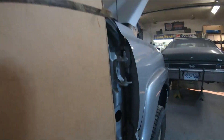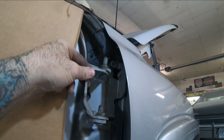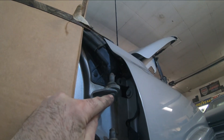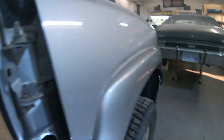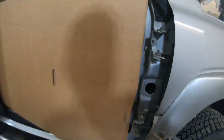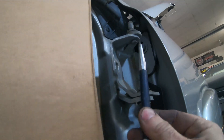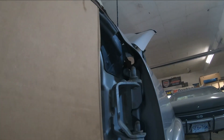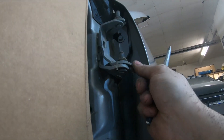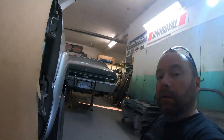Maybe I should have started this video on the passenger side. I was just getting ready to do this side and thought I'd show you what I was talking about. You can see this hinge also has a lot of play in it, and this is a factory door pin — you can see the way it's mushroomed over on the end. On this side I need to take a little cutoff wheel and just buzz through the bottom of that pin. Once that bottom is cut off, you need to take a punch and hammer them through because they're in the hinge pretty good — a friction fit. That's what the factory pins look like if that's what you end up replacing.